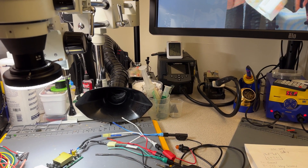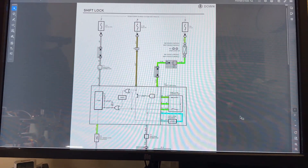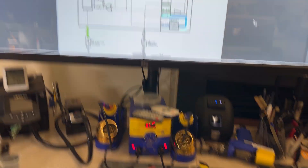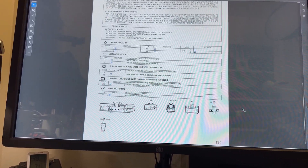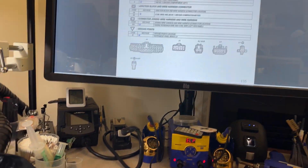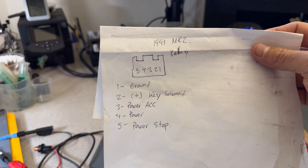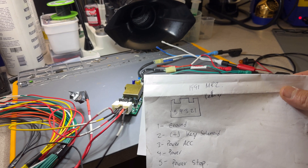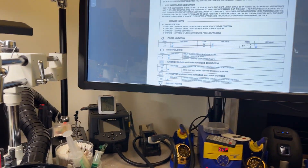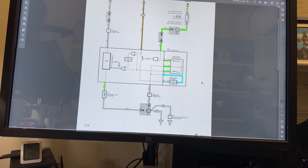I want to do the tests and show you the wiring diagram which I have open right here. Identifix has all their manuals with original information. This connector — S7 — the manual refers to it here. This is the actual connector in the vehicle, and then the connector on the component, so the numbers will be kind of like backwards because you are plugging in that module. Pin one is ground, so ground to ground, and it will work.